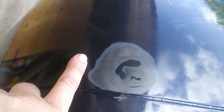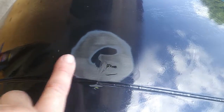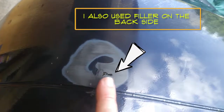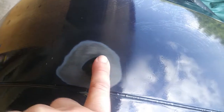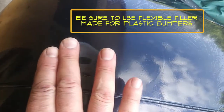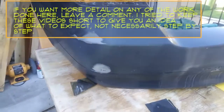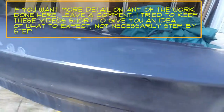If you notice it's still the color of that, which means when I'm sanding over this, it's low because my sandpaper isn't reaching it with the board. So what I'm going to do is take some sandpaper with my fingers and rough that up, get rid of that, and then I'm going to put filler in here. The filler needs to go a little bit higher than the rest of the surface, then I can smooth it over and feather it all in.